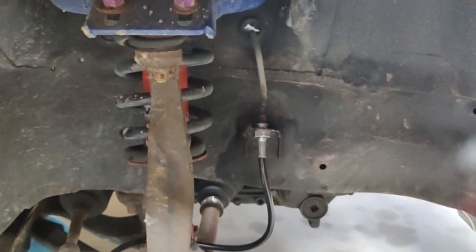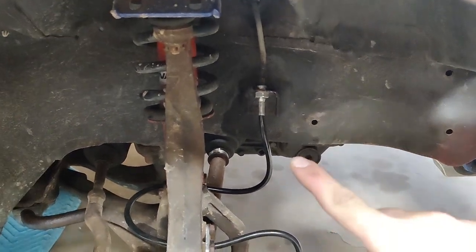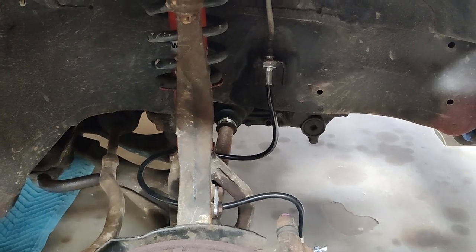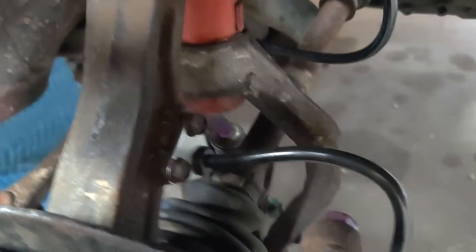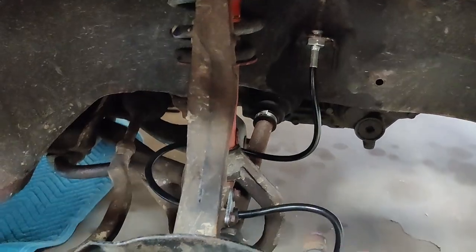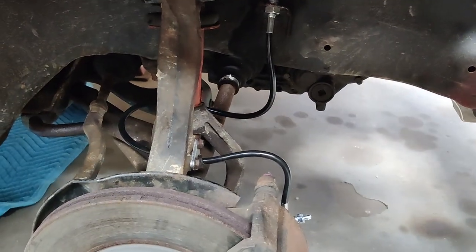I didn't do anything with the front brake lines but I did order the full kit that allowed me to put braided lines on all four corners, and here's where things got interesting. These lines are also from Chase Bays from that same kit, and one of the weird things about them is while the fit and finish and quality is very good, they were about five to six inches longer than the factory line. They came with two mounting tabs — one that goes to a two-point bracket on the knuckle, and another with just a single hole. There's only one place to mount on the factory location and I didn't want all that line up front near the wheel rubbing or being unsecured.